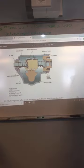Okay. So look at the picture on 1475. Okay, so as the steering shaft rotates, this is what rotates when you turn the steering wheel. So as you rotate this, this moves this way or this way on these threads, just like a nut would if you moved it up and down on a bolt. And as it does it, it turns this, which is actually hooked to the steering link, which turns the wheels. Right, so this moves and not that nut. That nut moves? These are just recirculating balls. That's what they call it. These are the bearings that the nut rides on the shaft that allow this to move back and forth without wearing out. But that ball nut does move. Yeah, okay. Absolutely. Think of a bolt. Take a bolt, put a nut on it, and screw it on. It moves one way, unscrew it, it moves the other way. It does the same thing. Okay, I got you.